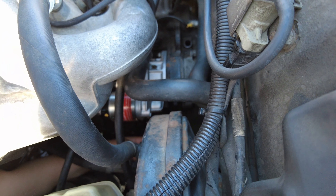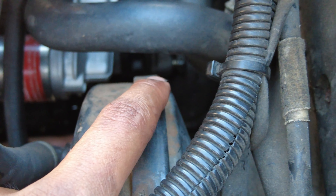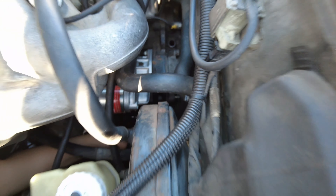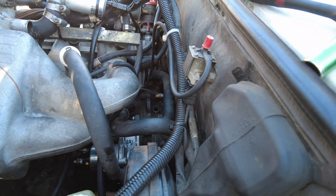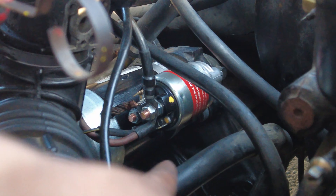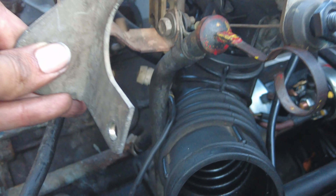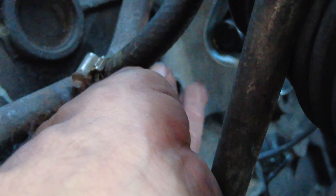So I'm going to go ahead and put the starter back in. Now that I've got the starter back into its place, I already tightened up the top part. Now I'm going to go ahead and tighten up that bolt that you see right there. I've got my girl helping me on the E30 right now. Now that I've got the starter in, I connected those right there, and now I'm going to go ahead and put this bracket into its place, just like so. So that bracket goes right there.